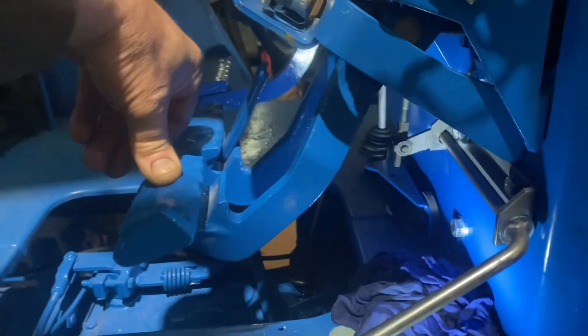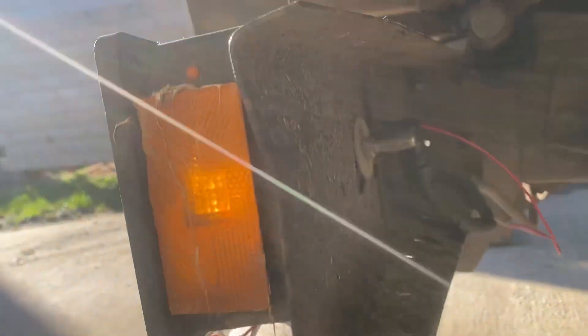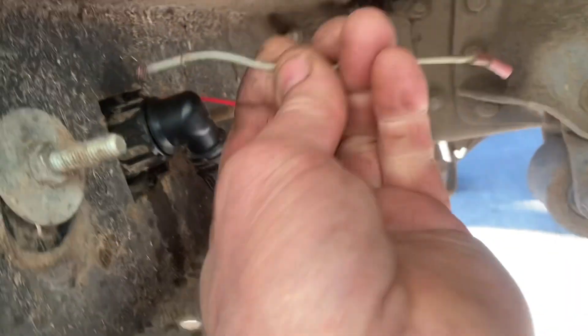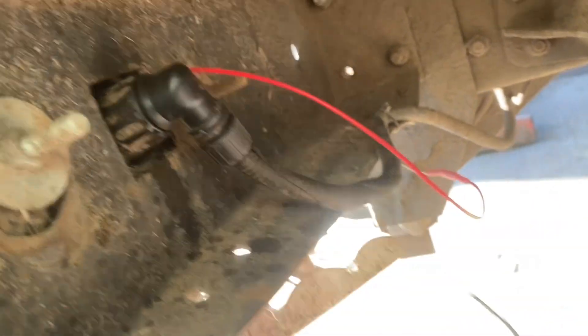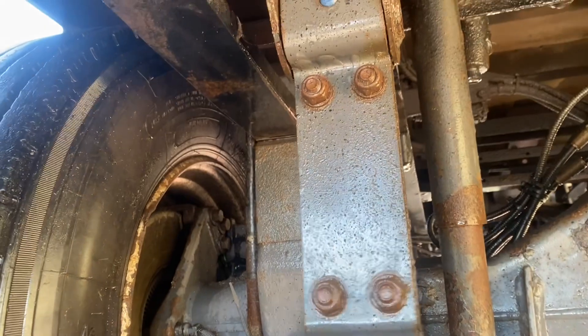About bloody time. Don't I just love wiring faults - brake light didn't work. Traced it back: this wire here was broken in the back of that plug, so we just routed another wire through because you can't get the damn things out. Joined it in, taped it up, sealed it up - job done, it works.